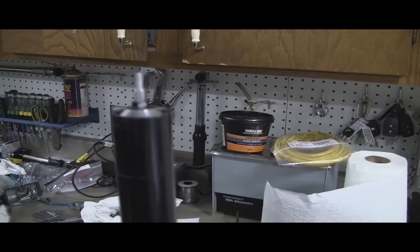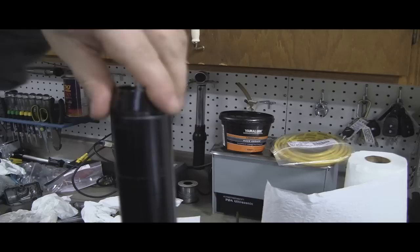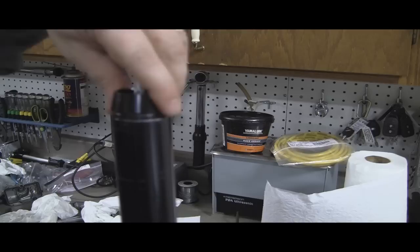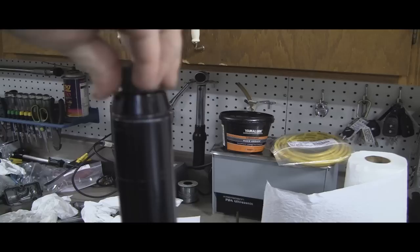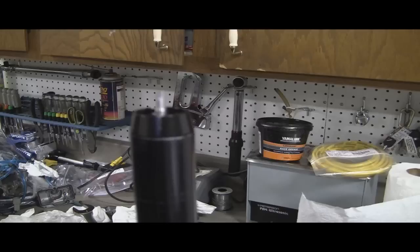Hold those in there and then simply slide the rest of it up. It looks like we're pretty good there. Make sure it's going down as far as it needs to go, and it is. The next step would be to put this piece back on — this is the piece that we used the tool to remove. Go ahead and put it all the way on, but we're not going to tighten it up all the way, and I'll show you in a bit why not, if you've got a lockout especially. Make sure you don't cross thread. We'll tighten it down a bit and then I'll show you why you don't want to tighten this all the way just yet.